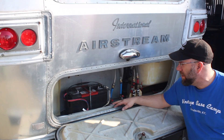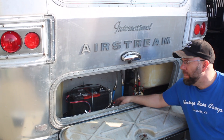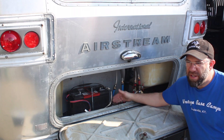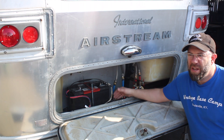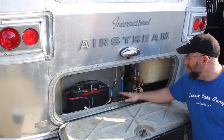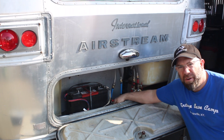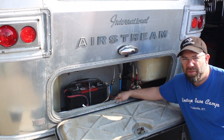The frame was in really good shape for this period — usually a lot of frame work is needed. Airstreams had a design flaw with an opening in the back that structurally weakened things, though it was there for access to dump valves and shutoffs. They raised everything above the floor grade, installed all shutoffs, used PEX plumbing, put in a new battery and battery mount, and laid solid flooring that ties well into the channel on the frame.